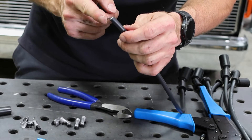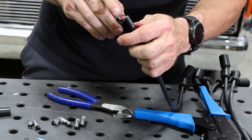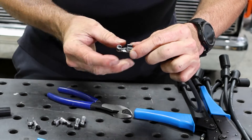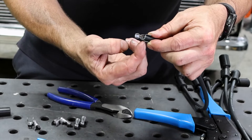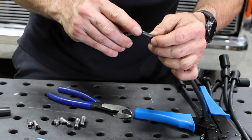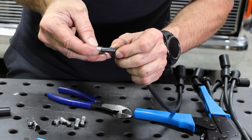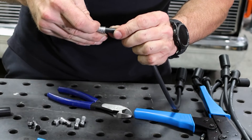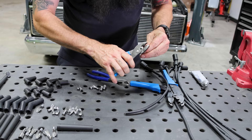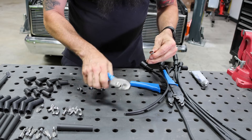Next step is we're going to bend this piece over — just bend it over so this piece here clamps down on it, clamping this lead to this, and that's how it's going to spark. The thing to remember is you want this housing almost flush here with the top edge, and this piece should be down in here but must not stick out past the end. If it was sticking out it's going to misfire, so this should be completely covered up. We'll bend this piece a little bit extra to help the crimper get started on it and make a good shape.